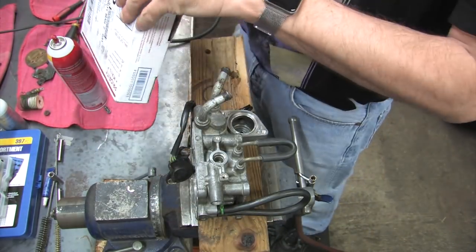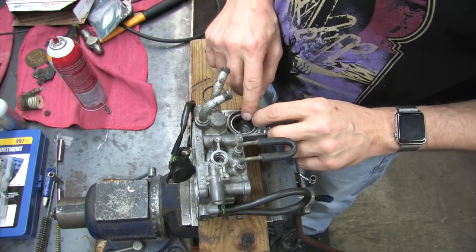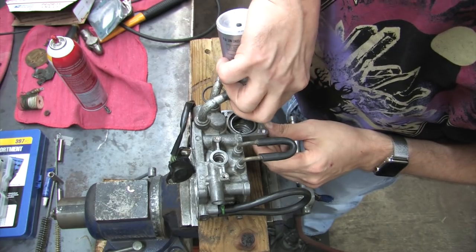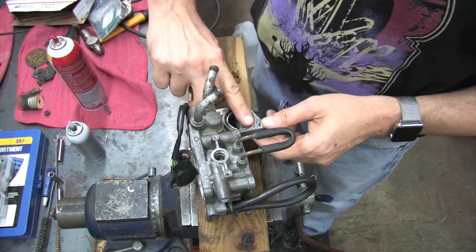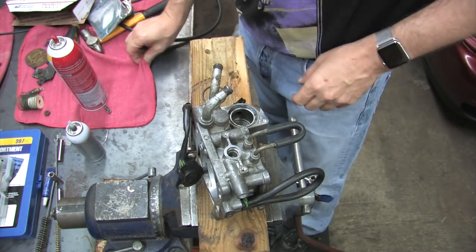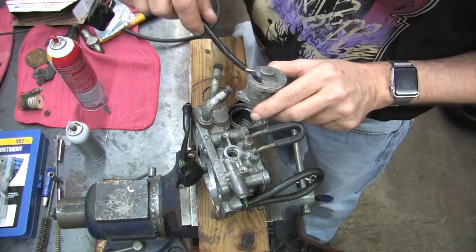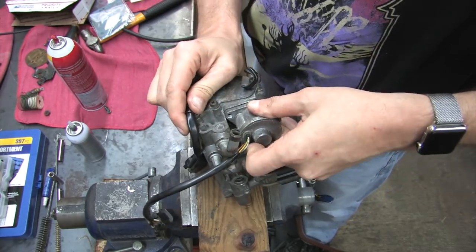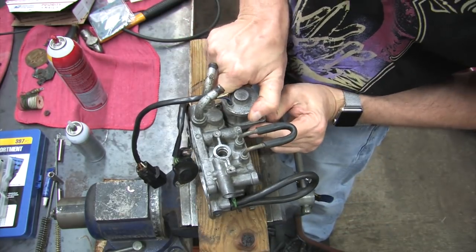So with all of the idle speed control parts cleaned, it's time to replace the seals and put it all back together. All the part numbers for the stuff I use in this video are in the description, but this ISC O-ring is just a standard number 28 O-ring. Mitsubishi used this O-ring on practically every car, truck, and forklift they made from 1988 to 2000, so it's never going away. That's a good thing, but what stinks is that one of the shaft seals for this 1990 throttle body is completely sold out and unobtainable now.